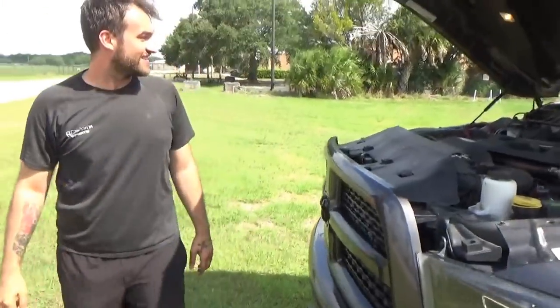The first time I was driving down here and a battery voltage warning came up. Thought maybe I just had a bad battery or something. Next thing I see, it keeps dropping down to below 8. That's when things got a little hairy. All my warnings started popping up. Actually, I'm going to shut down completely. Wow. Came back, luckily made it to my parents, but then got the alternator replaced.